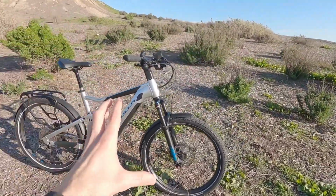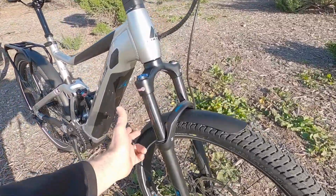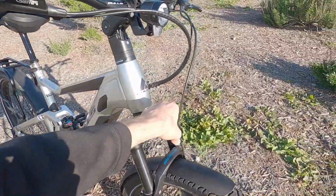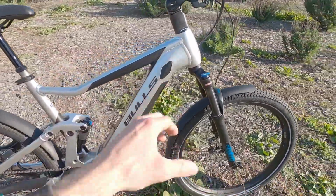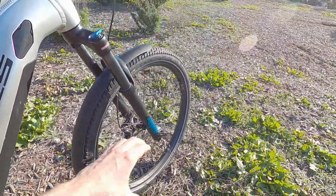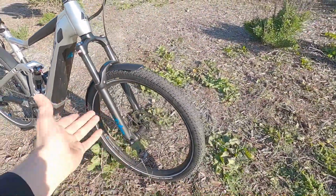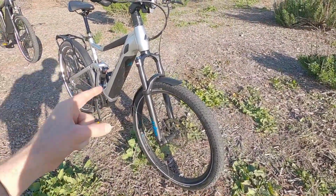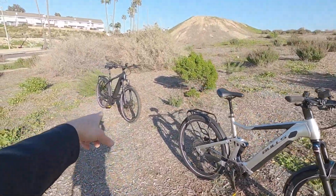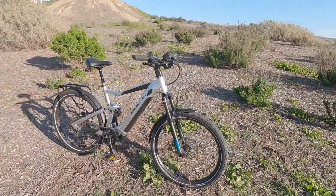And they've got a very similar suspension fork, 120 millimeters of travel up here, black anodized stanchions, 34 millimeter. We've got a lockout over here. You can sag it because it is an air fork, so a little bit lighter and more adjustable in that sense. And we've got rebound adjust at the base there, so how quickly it rebounds into the original position. Boost hub spacing, 15 millimeter through axle, heavy duty, sturdy, 203 millimeter hydraulic disc brakes front and rear. That one's only got a 203 up front and a 180 in the rear. So again, little upgrades all across.